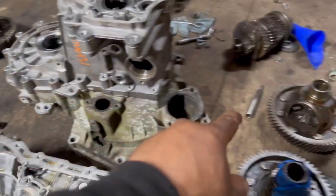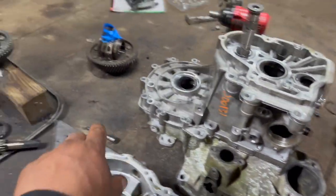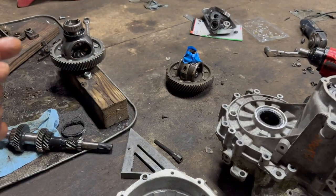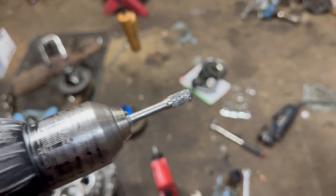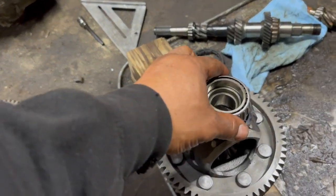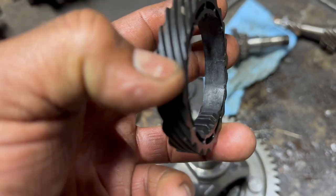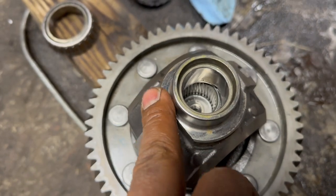And then pull from an old transmission the gear, the speed sensor, because that one doesn't come with a gear sensor. And then I ground it with a drill and a bit. I ground it carefully. And that's where we're at right now. So I wanna document this for the future, maybe for myself. I ground this, and now it's good. So the differential already has the two notches.